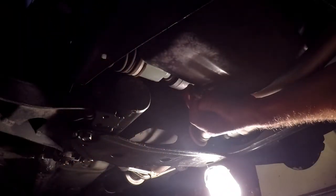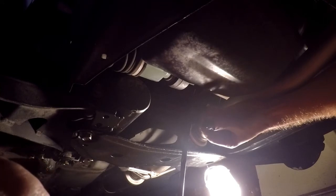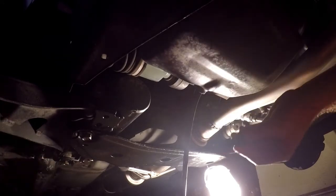I'm trying not to strip anything or knock anything loose. Don't use too much leverage like I just did. Make sure you have your oil drain pan here. Try not to drop the bolt in the oil — that makes for a hell of a messy experience. Keep in mind that the oil will slowly move forward as it comes out. And good lord, look how dirty that is.